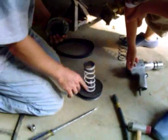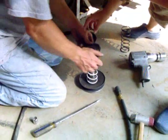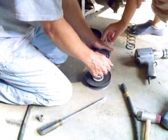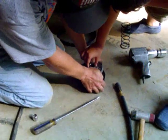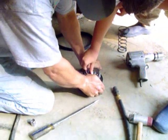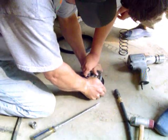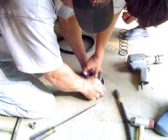We're going to go ahead and do this — it takes a couple people. We've got our spring in place. We'll put the clutch assembly on. I'm going to hold it and compress it while my son puts the nut on. Make sure everything's centered and we'll give it a shot. Go ahead — keep going as far as it'll go.